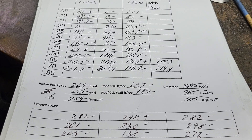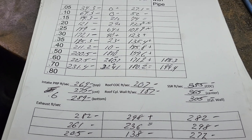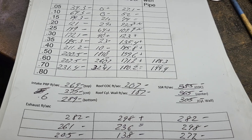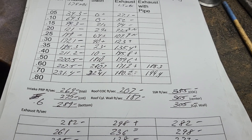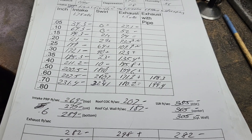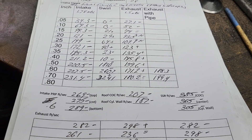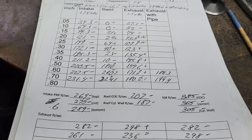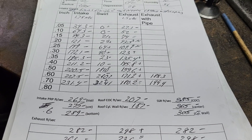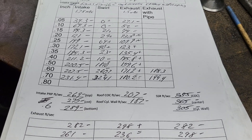Thanks for hanging out. I hope you like the Mission Impossible update and this little tweak that we did today. By the way, I dropped a bolt into the flow bench, so I had to take the whole flow bench apart. Since it's apart, I might as well throw a plate on it and see how close it is — 300 plate reads 300.6, so I'm pretty good with it. The calibration is staying at least on range four. The bench really doesn't change much — you only have to change it when the weather changes drastically. Thanks for hanging out, have a good night.